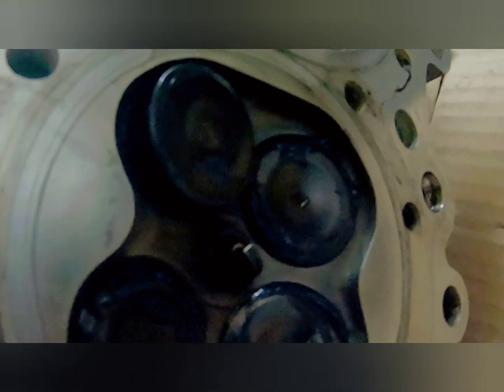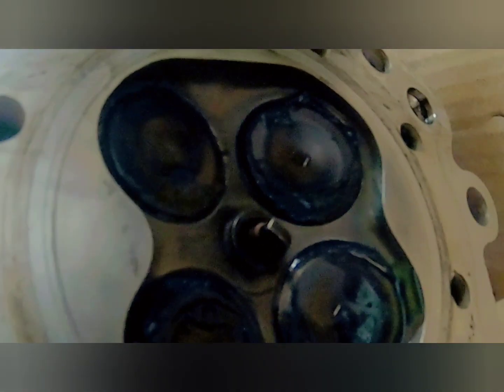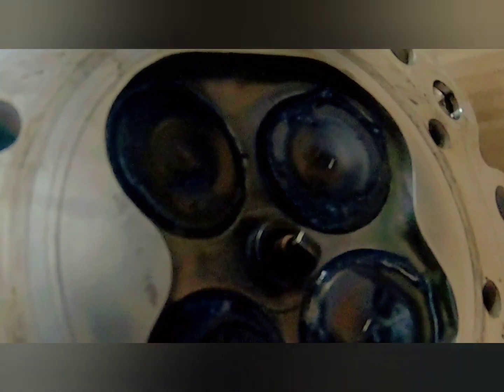So what I'm going to be doing here is I have it in forward, so I've got it turning to the right. I have the compound on, as you can see. I have the drill on the lowest speed. So I'm going to go full throttle on the lowest speed, have it out a little bit, then pull it in — one, two, three, four.